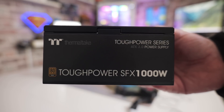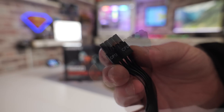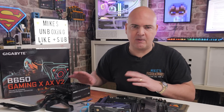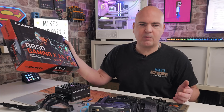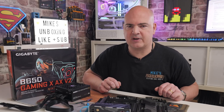You don't need too many connections — all you need is the main 24-pin power connector and also the 8-pin CPU power connection. Also, things which are handy to have include a motherboard box just to put your motherboard on to stop it getting static and to support the board during the flashing process.